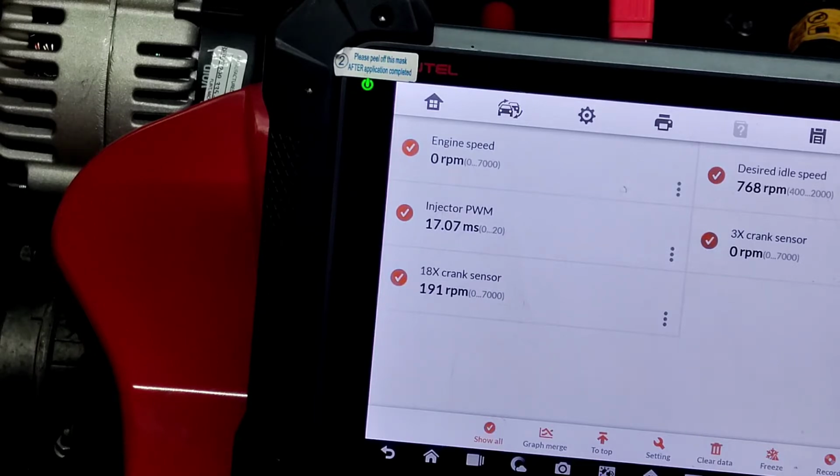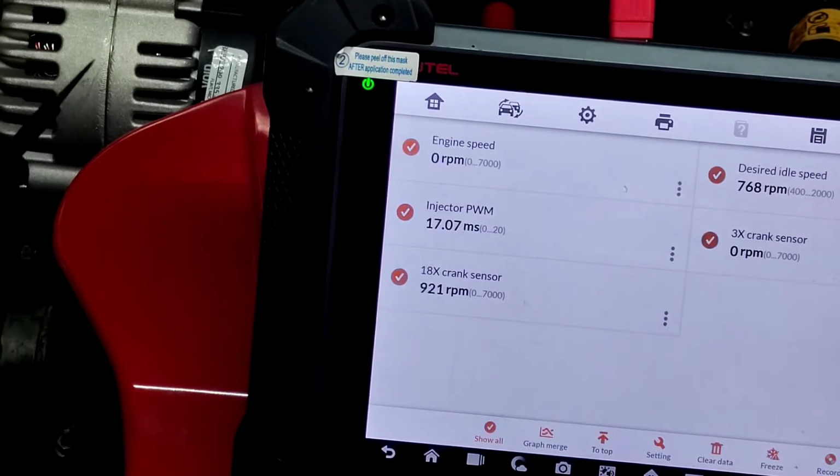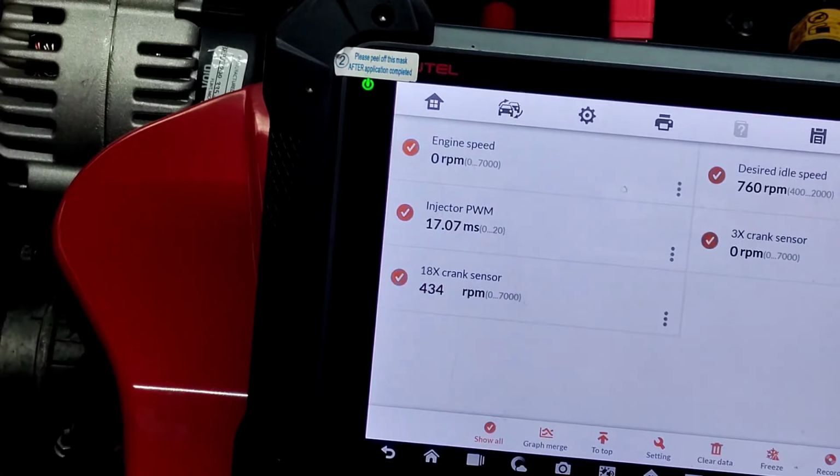I'm going to take a test light. I'm just going to use the connected here to the alligator clamp, and I'm just going to use this end here to see if I can generate a signal. I'm just going to touch the alternator, which I did. See that changing? So it does detect the drop-off signal. Let me see if the RPM changes also.